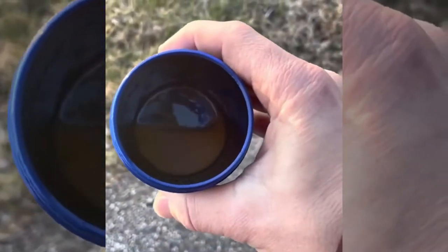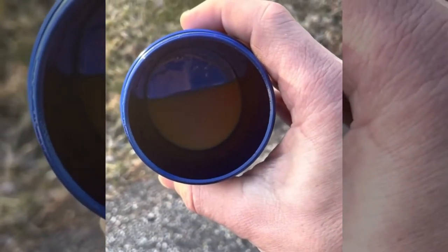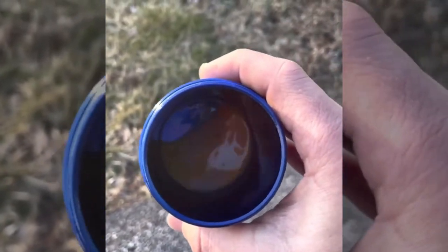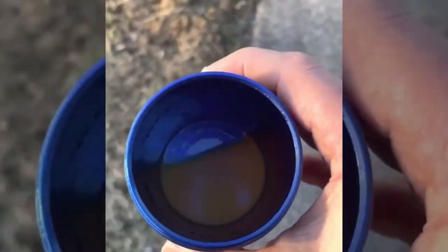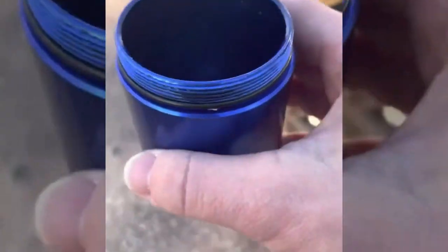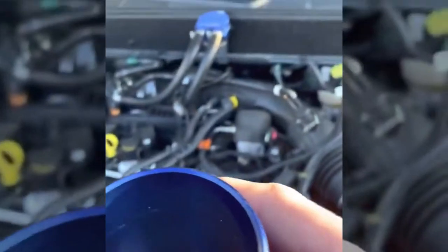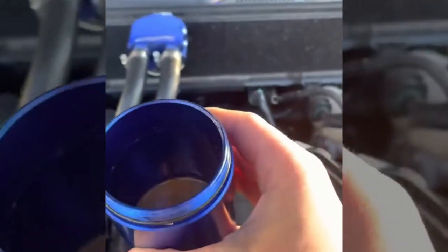Before you write off this method, be aware that real-life tests show that a substantial amount of slush is being collected from the valve cover clean side. That is because inside the engine block, it is all one common chamber. In my opinion, both the top and the bottom need addressing. For this reason, I decided to combine them using a T to extract as much crankcase fumes as possible.